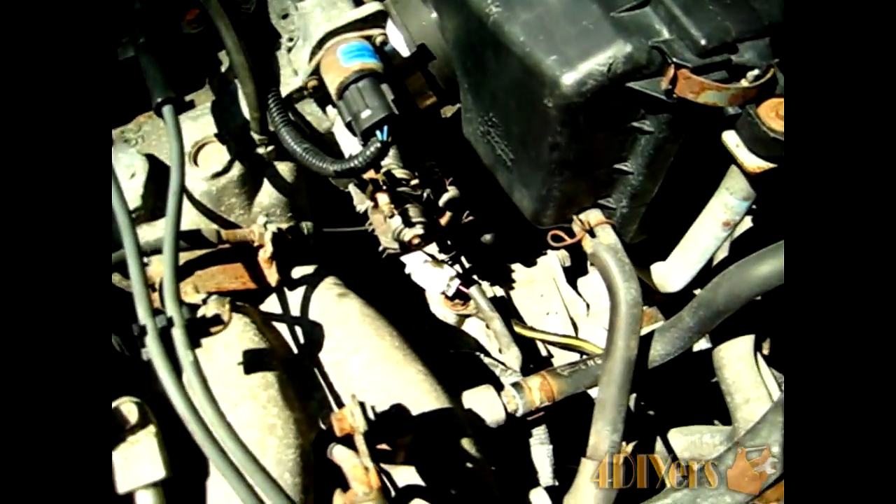For diagnosing the knock sensor — I've already replaced the one in the vehicle and everything works fine after that. Here is the plug for the knock sensor; you can see the sensor is directly located right down below. To begin, you'll want to take a multimeter. Unplugging this connector, which is held on with a small depressed tab, reveals just one wire going into the sensor, and the sensor grounds out on the engine block.